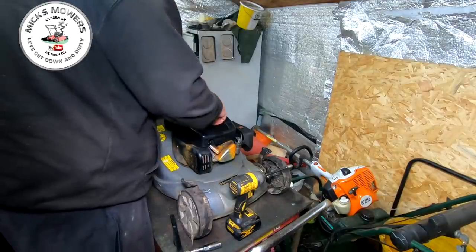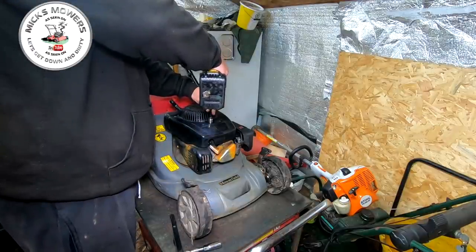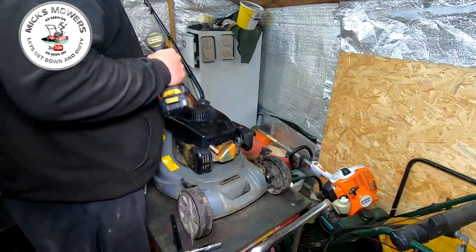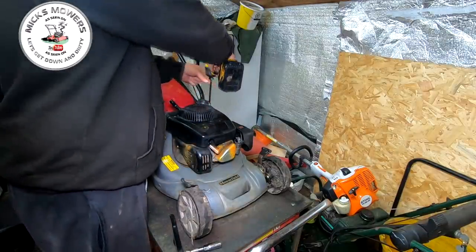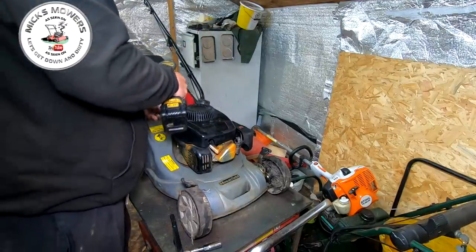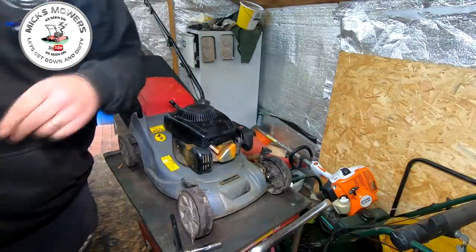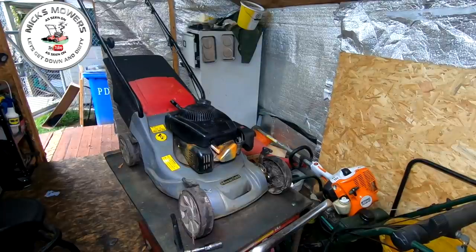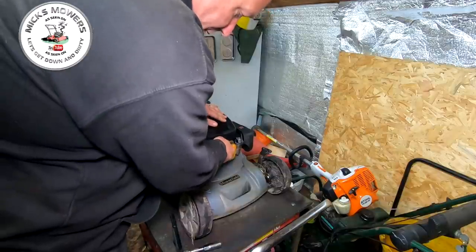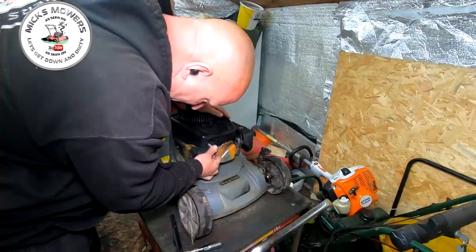Why was it thrown away? Was it because the front was a bit wobbly? Maybe. It may have failed to start. I've still got to spray these covers and HT lead because there's still some orange paint on there. What I might do is give it a quick white spirit bath all over, and then once it's dried off and clean I might just hit it with some lacquer just to make it pop a little bit. Now putting that cover back on and the HT back on — watch me struggle, they're absolute pigs.